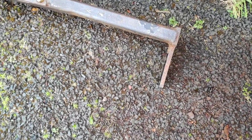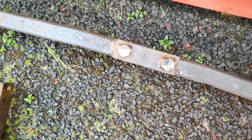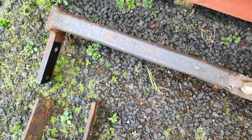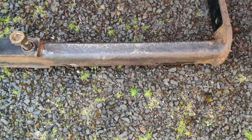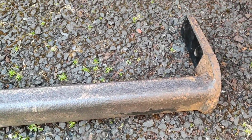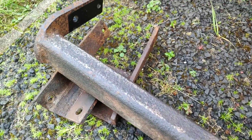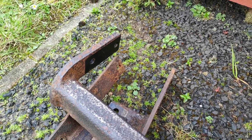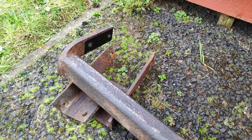So with our first passes of electrolysis done the tow bar actually cleaned up pretty well — it cleaned up a lot of the surface rust. I got it to a state where it could be cleaned a little bit further with mechanical cleaning. These items — if you leave steel out for any length of time in the rain it will reform the rust, so it's important if you do this don't leave it sitting outside. Try and get it cleaned up and painted as soon as you do the electrolysis.